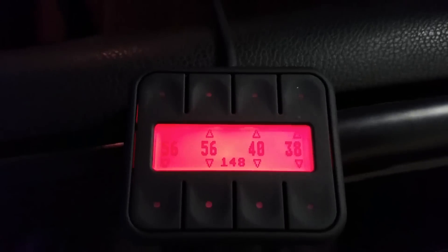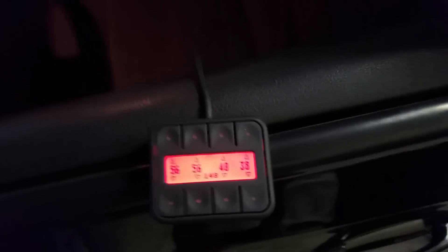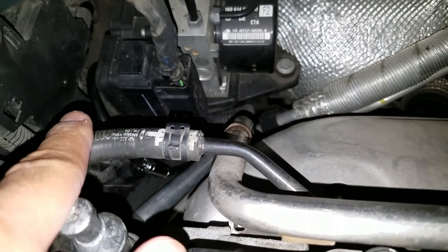This is the bag that had the leak in it. As you can see, we're holding 56 pounds of pressure pretty constantly now — I'm probably speaking too soon but it looks like we're okay for the moment. I'm definitely going to run a calibration on it, which will lift the fronts to about 100 PSI and back down slowly. I'll probably leave it and let it sit overnight at around 70 PSI — I want to see if it can hold that pressure overnight, and after that if everything is fine I'll run the calibration.